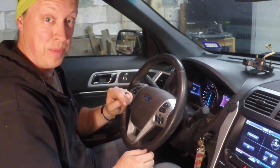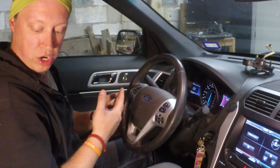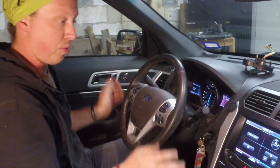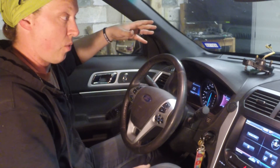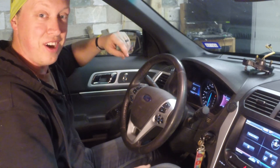That one part fixed everything — though at $180, a clock spring is expensive, so check other things first before swapping it out. If you have an airbag light or are losing steering wheel controls, check other causes first. But if you know it's the clock spring like I did, that fixes all the problems. If you found this helpful, please like it, leave a comment, and consider subscribing — we're frequently working on this Ford Explorer and it's some of the most popular content on the channel.